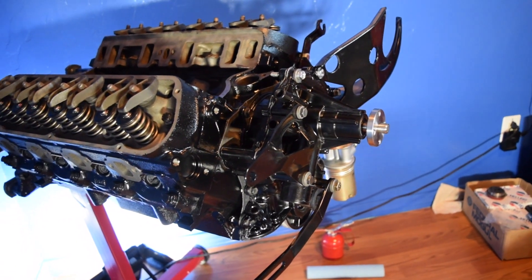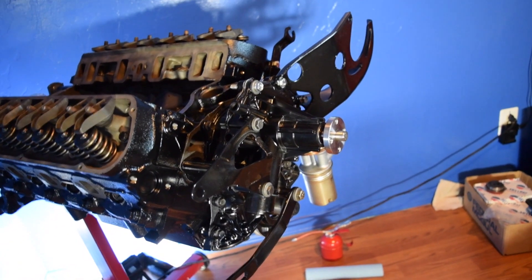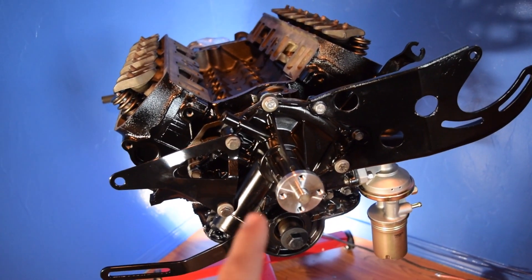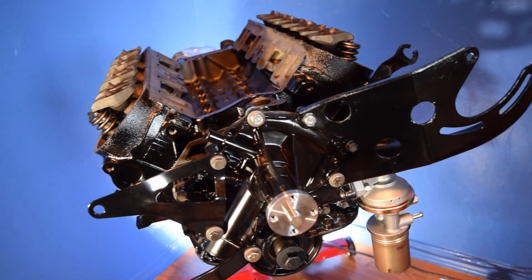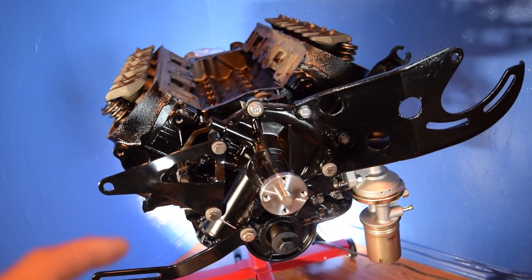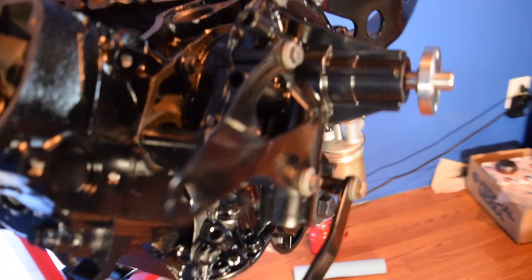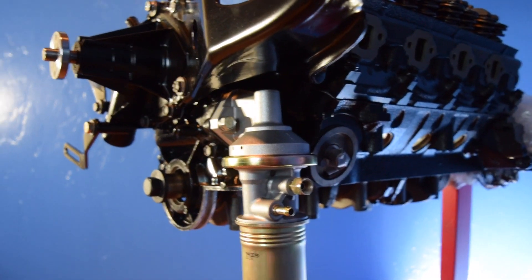I want to apologize — we had a couple of camera issues, so I wasn't able to record the water pump installation or the torque-down. After putting on the timing cover, I snugged down the bolts, put a light coat of RTV on the water pump gasket just like with the timing cover, made sure everything aligned, then put on the brackets so we could torque everything down at the same time. Everything accessible with the torque wrench got torqued down to 15 foot-pounds. I also installed the mechanical fuel pump while I was already in there — that got torqued down to 15 to 20 foot-pounds.